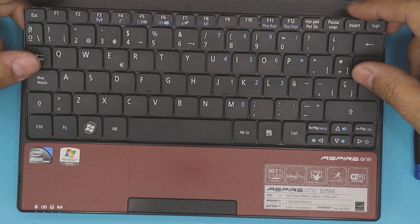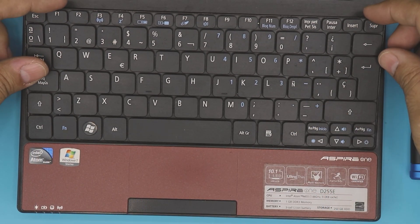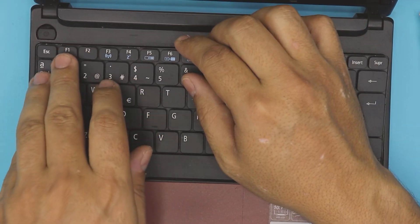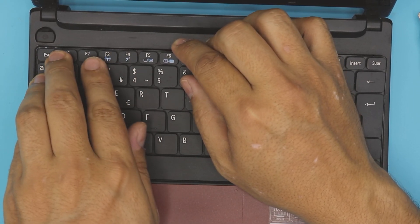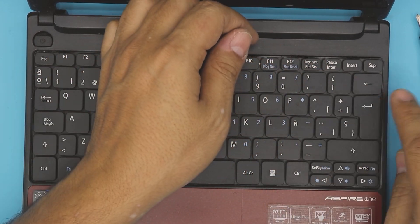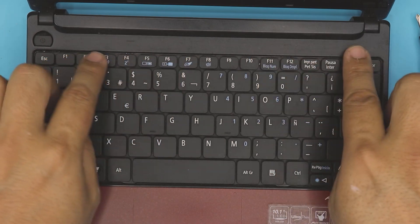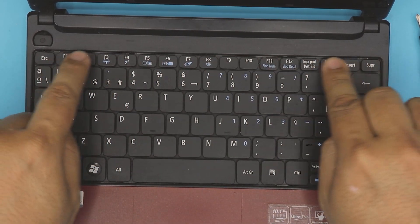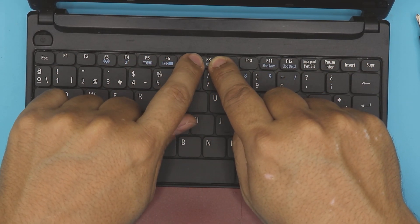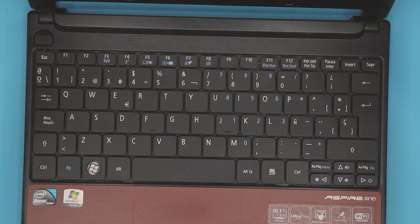Flip the keyboard over. Put back the bottom side where the space bar is and slide it underneath the palm rest. Grab it from the middle and give it a tiny curvature. Push down where the power button is in the corner — make sure you hear those clicks — then put it down and press down this side. On the top, press down from F1 all the way across — you'll hear tiny clicks. Once all the clips are visible and locked in place, the keyboard is secured.